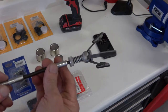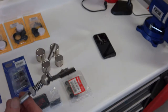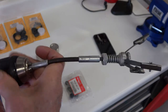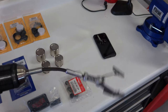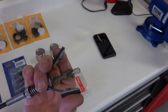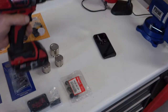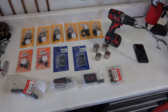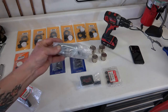You also need a brake honing tool that you hook up to your drill. You just take your cordless drill, stick it in there like you would any drill bit. These are really handy because they'll hone out the calipers and your master cylinder — they'll clean up all the corrosion or glaze that's left over from the old brake fluid. A lot of times it crystallizes and gets dried and it's really hard to get out of there, and that honing tool is really handy to get all that out.